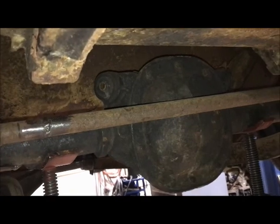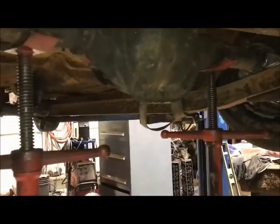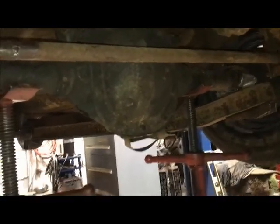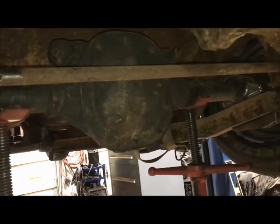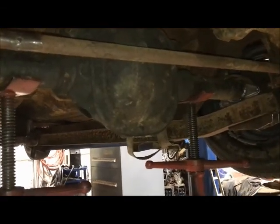So rear suspension now is done, except for rear shocks. Have to put rear shocks on this, and then the springs can go in. And of course the shocks can't be in the way of the springs, so keep that in mind as doing work. So next thing will be the rear shocks.